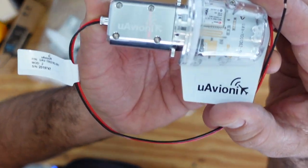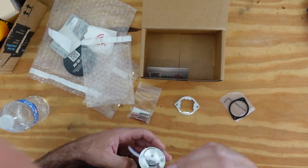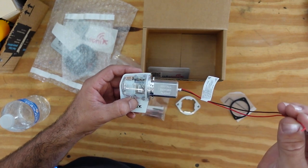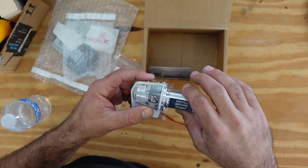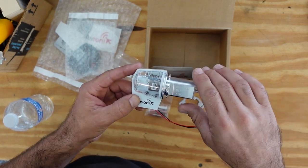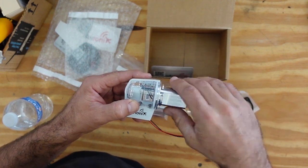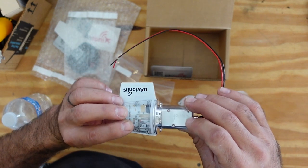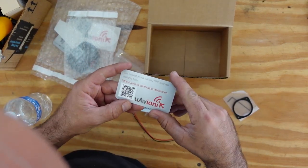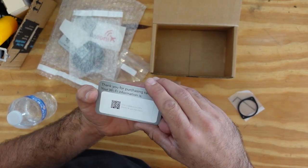Installation is supposed to be very easy. We'll just use these two stake-ons to connect to our tail nav light wires. The only thing I read online is that on some Super Cubs, the tube that the tail light on the rudder is located in is a little bit too narrow, so some guys were having to grind out the inside of that tube. Last but not least, and probably most important, is the installation manual and STC data - it's a little QR code and we'll scan that with our iPad.